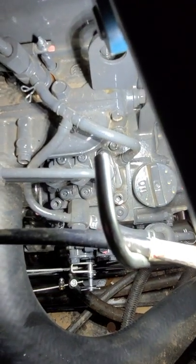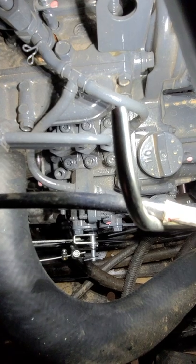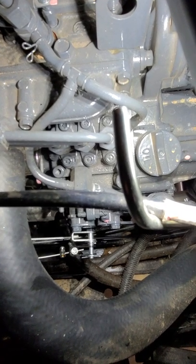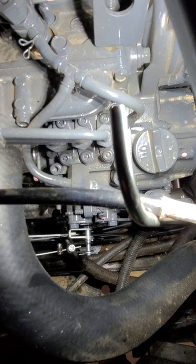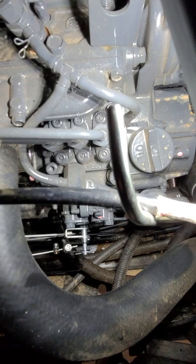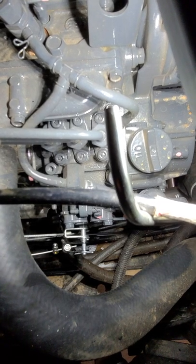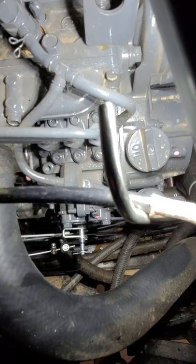You do have to play with it some, and it is a little frustrating to get the adjustment on those nuts right. There are stop nuts right there that are attached to it — those are a little frustrating — and you want to make sure you've got those good and tight. Biggest word of advice: I trimmed my cable and I was okay, but do not trim the cable until you are absolutely sure that all of your adjustments are correct. I had plenty of slack left, but don't trim that cable until you are sure, because if not, you are out of $180 — you'd have to get a new cable.